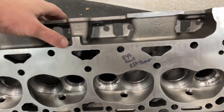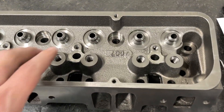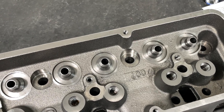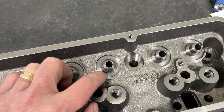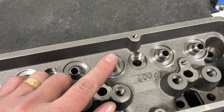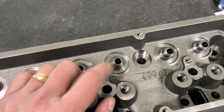Let's look at the rest of the head. It's a 165cc intake runner, so it's pretty small, as you can tell. Unlike a lot of aftermarket heads, these do not have bronze guides — instead it's cast iron. Pretty much what they do is cast the head, then use a tool that runs down and reams out and resizes the guide hole. That's your guide right there. They're not replaceable like you'd see in most aftermarket heads where you can just pound one out and pound another in. These actually have to be cut out if you want to do a replaceable press-in guide — they're cast on the head.